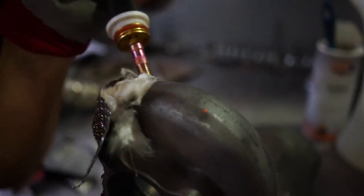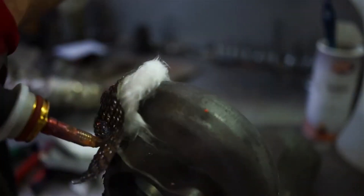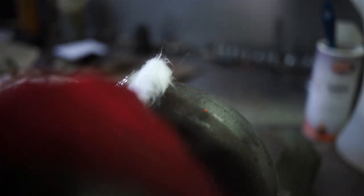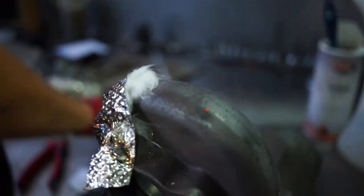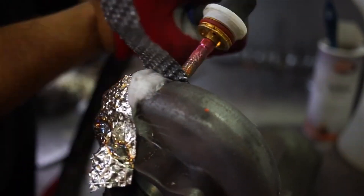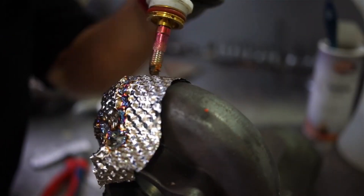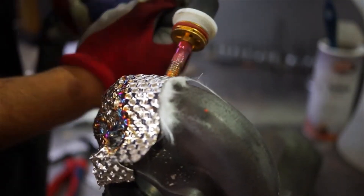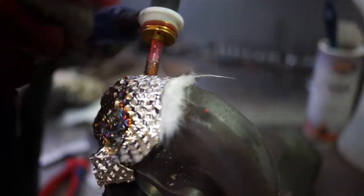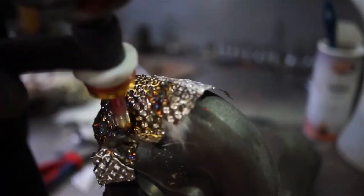So keep in mind you may need to run more fuel to cool the EGTs, or run less boost, or adjust ignition timing to get EGTs lower. The same applies to exhaust manifolds — especially if you use exhaust wrap, which I again wouldn't recommend, because if moisture gets trapped in there it can promote oxidation and rust. Heat insulation using materials actually designed for exhaust manifolds, such as good quality stainless steel that can handle those temperatures, will be fine since there's not much oxygen in contact with the manifold, so it won't rust as fast.